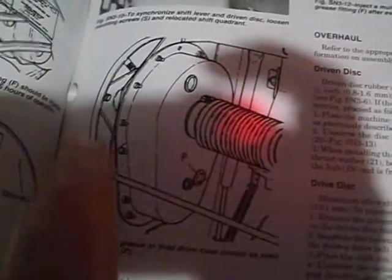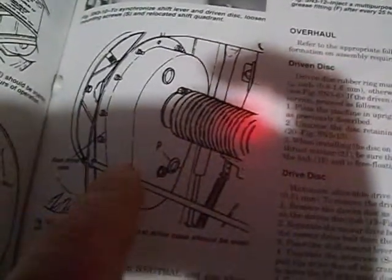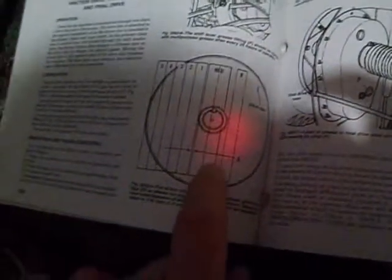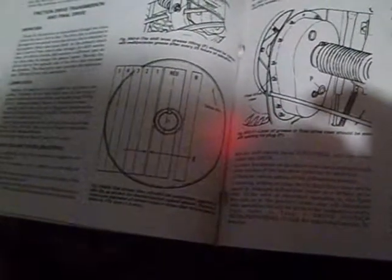If I can find the Snapper stuff in here, I'll show you what I did with mine. I took that differential case apart — there are bolts in it. My friend and I put a chain in there, put the link in the chain, and pieced it back together. Right there is where you put the grease in for the Snapper. They also have these weird rubber wheel disc things on them. Mine has three bolts on it, and there it shows you how to correctly adjust the engine disc on the rubber disc so it shifts right. If you're missing the Snapper manual, you can just get it in this book.